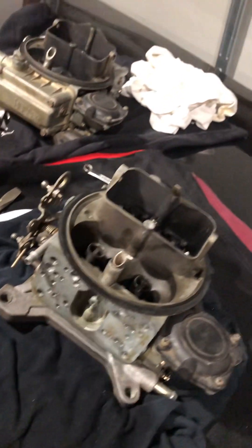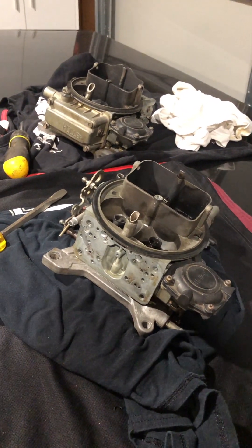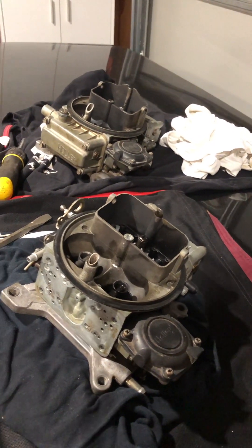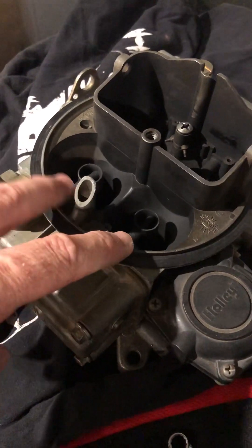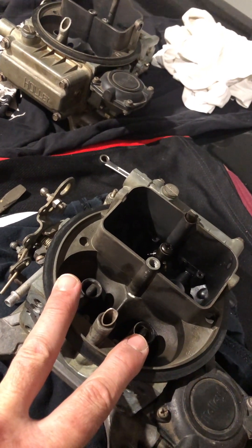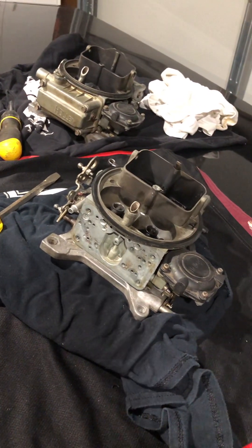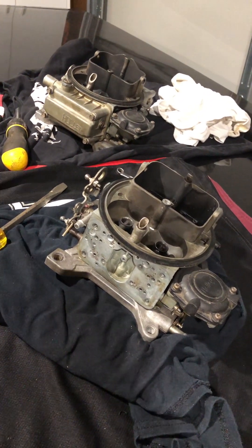Steve's coming out tomorrow. We've gone back to 56-sized main jets because it was still running too rich at cruising — 10s to 11s on the AFR. The vacuum secondaries may have been leaking and dropping down this whole time, causing it to run rich. We need to do some road testing. Still got the AFR gauge hooked up, so we'll get the car back together and have another crack tomorrow.